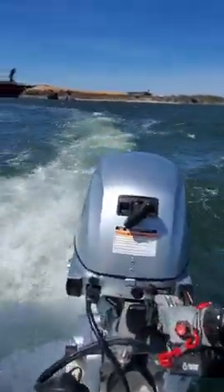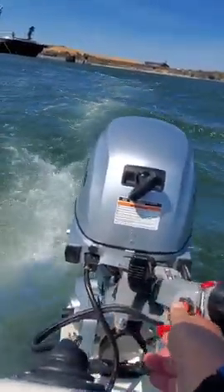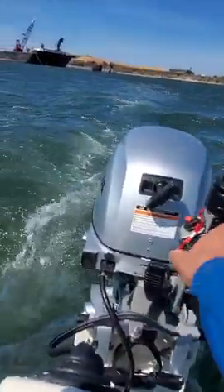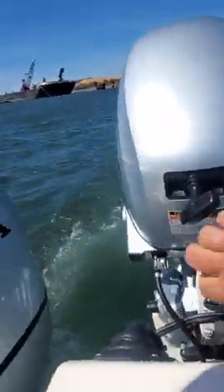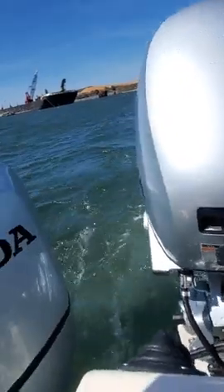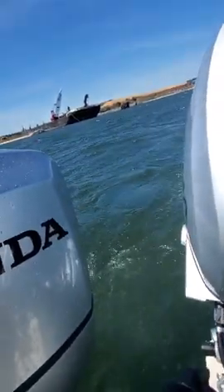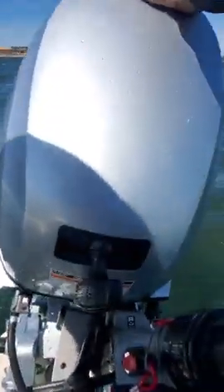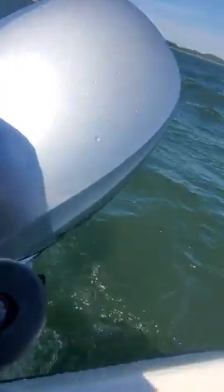The kicker works good. Bring her down all the way, bring her back into neutral, then hit the kill button, lift up on the kicker handle, and put your finger up here to make sure it doesn't go down. I'm going to pivot this like this — loosen up that friction with the handle.